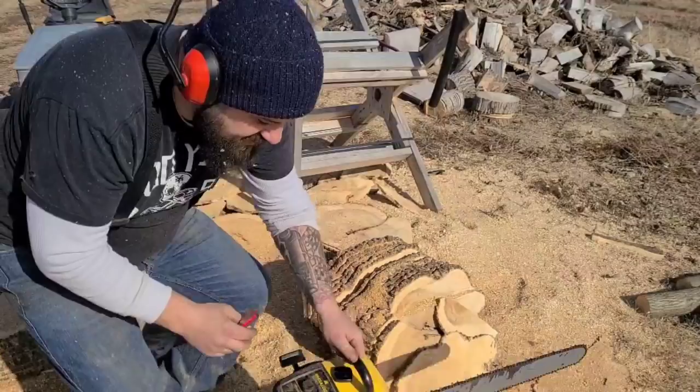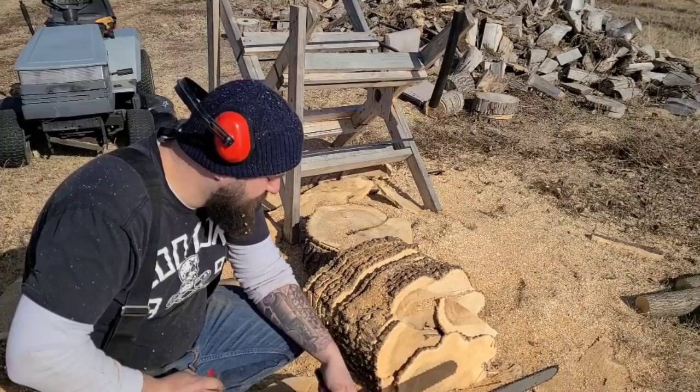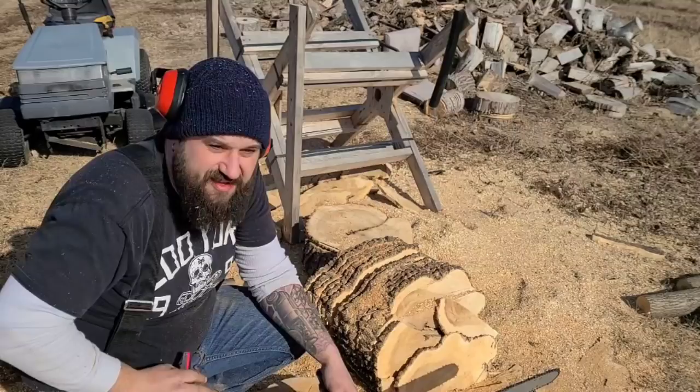Okay, so this power saw doesn't have an air leak. I've tried several carbs on here. It's a little slow to get down to idle, but you know what, friends? I think that's just how this saw is going to run. This saw has a huge flywheel, huge crankshaft, and a big clutch, and I think all we've added thousands of RPM to this power saw speed. All that mass is going to take a little while to slow down. And as long as it idles and settles down, restarts.